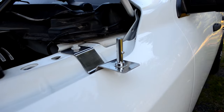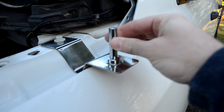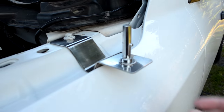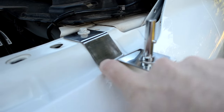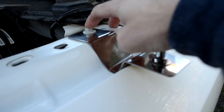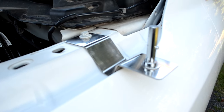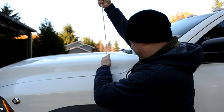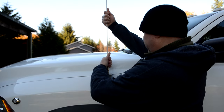Here's where I mount the safety flag. The male side of the quick connector and a generic stainless steel hood-mounted CB antenna bracket — both bought off Amazon for about $12 and $30 respectively. The bracket has double-sided tape underneath and mounts under an existing bolt — no holes to drill. It's really sturdy. Mounting is extremely straightforward: the flag just pops on, push it down, rotate it, and it's locked in place. When you're done off-roading, push back down and it pops off.